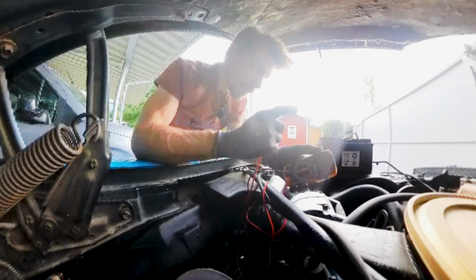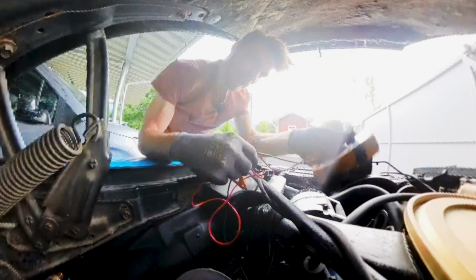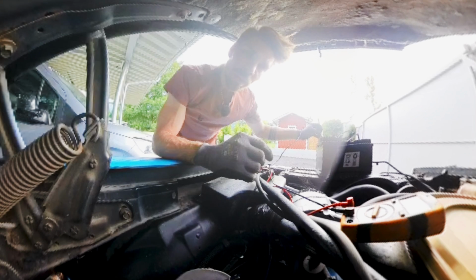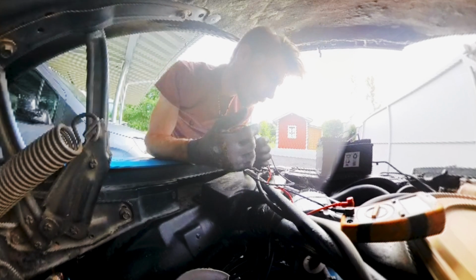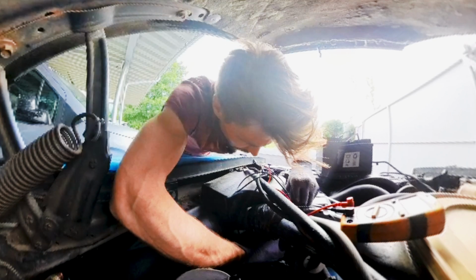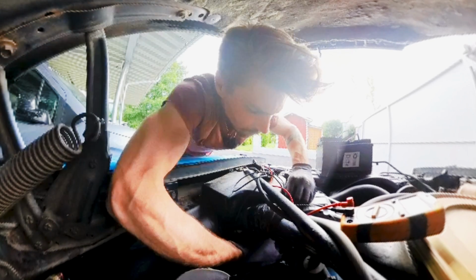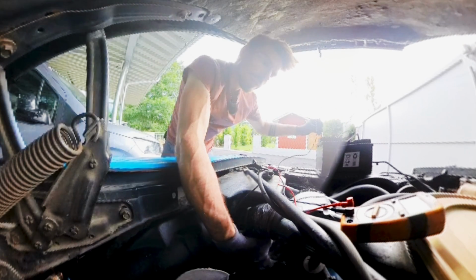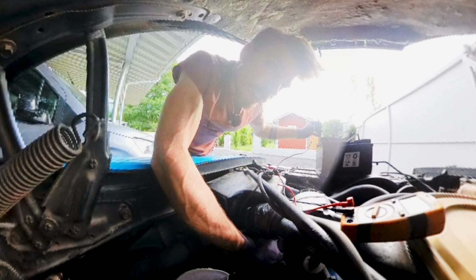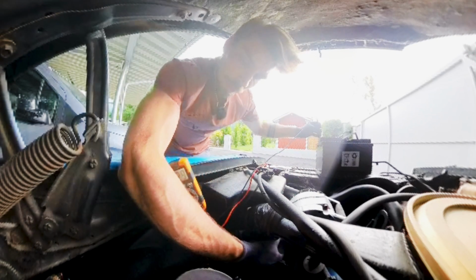So with this wire off, I wanna retest my Parasitic Pro. Maybe this resolves my 0.3 amps. Who knows? 10 amps. 0.3 still. Alright. And when I pull out this plug here, it should drop to zero, if I'm not mistaken. Zero. So something here keeps drawing it. I plug this in, I'm about 0.3. This is this two blade connector plugged in.